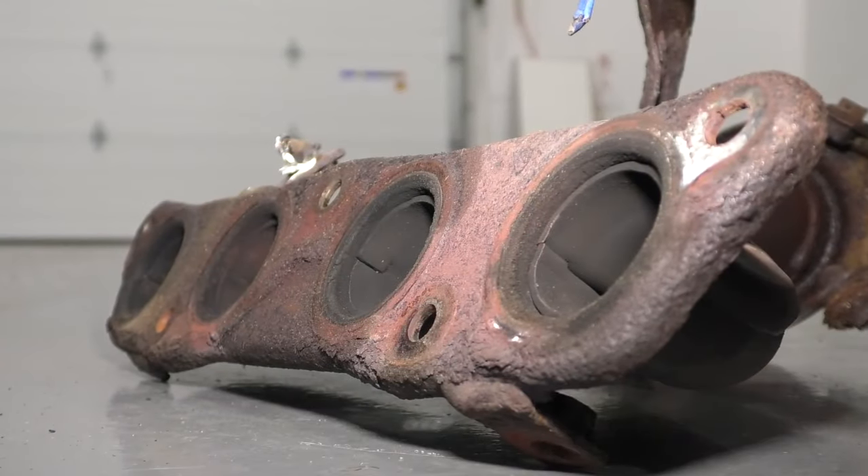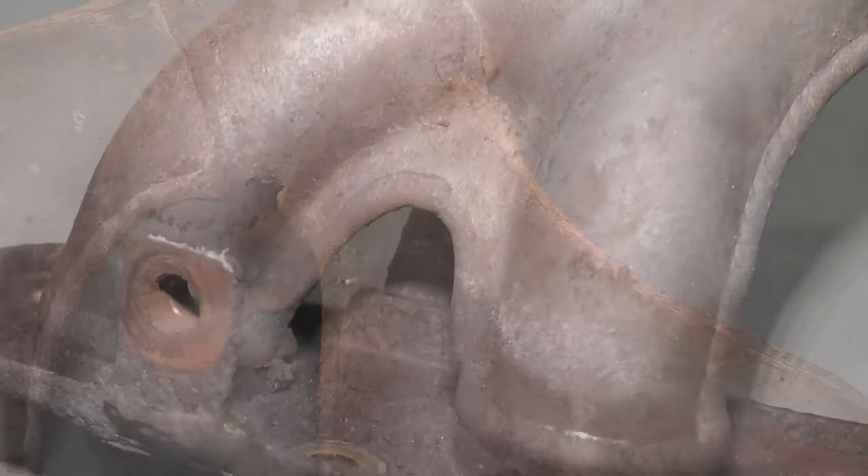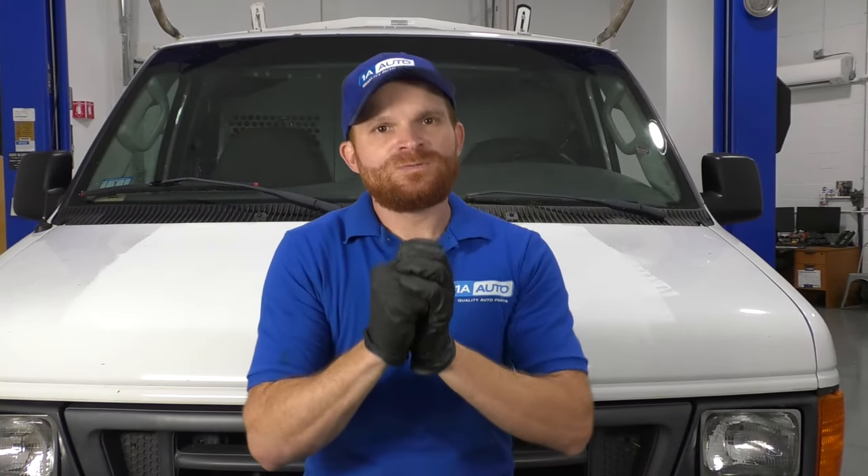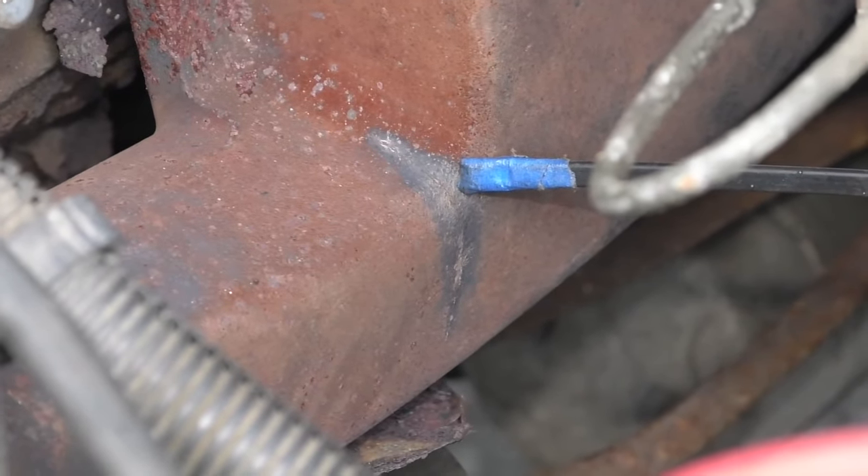While the manifold's off, it only really makes sense to inspect it. A lot of times you might have multiple issues — maybe you replace the manifold studs, replace the gasket, and next thing you know, you still have an exhaust leak. Did you check the manifold for cracks? Manifolds will get cracks along some of the seams or at any bends. Manifolds get very hot due to exhaust pressures and temperatures. If the metal expands from heat and then contracts very quickly — maybe from a splash in a puddle — it might crack. The crack might be a very small hairline crack, but if there is one, more than likely there's going to be some soot around it, whether black or even a little bit gray.